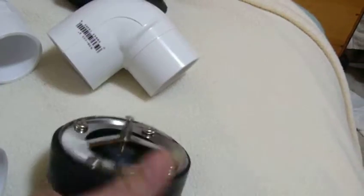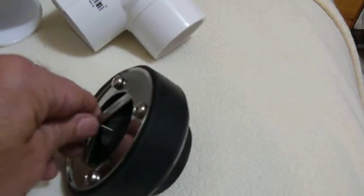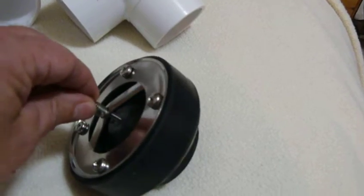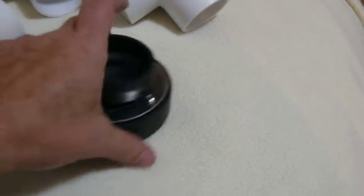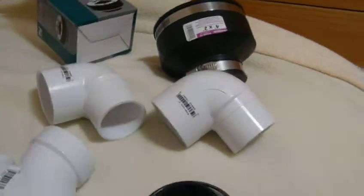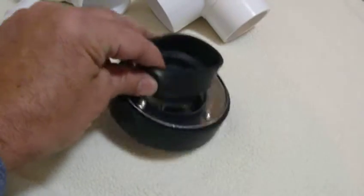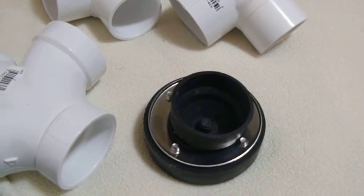You'll probably want to take the screw out here, take it off that piece of rubber, and put some glue on the end of that screw, then screw it back in about a quarter inch. You want as much play as you can get — you want this to be as open as possible to release the pressure of the two front vacuum motors through the restrictor of the check valve. The check valve restricts the air going into the third vac, and this relieves the pressure from going into the third vac. That's why I think this system works well with a three vacuum motor system.